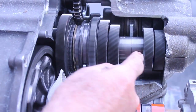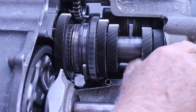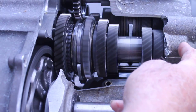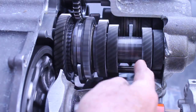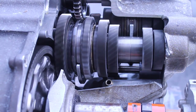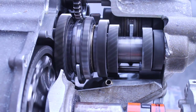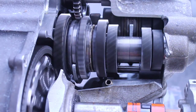You'll notice this shaft is moving slightly side to side — that's not supposed to happen. That's basically because the little snap ring that was in here has been removed, so normally this can't shift side to side. If we go now, you can hear the output shaft speed up as the synchro actually gets the two gears to turn at the same speed, and then you finish the shift.